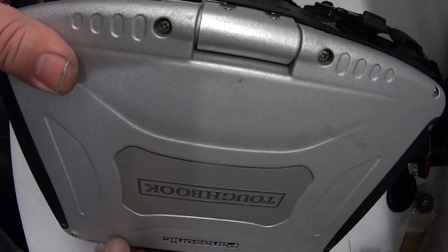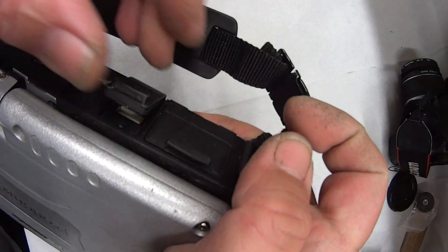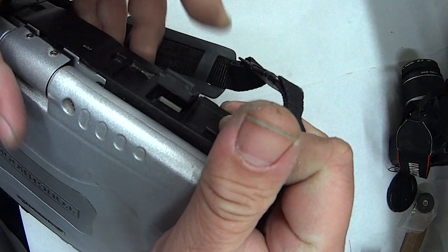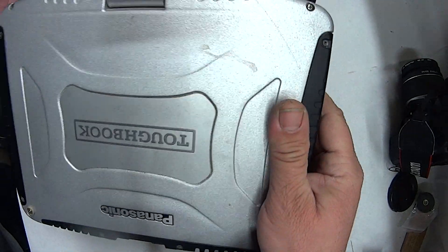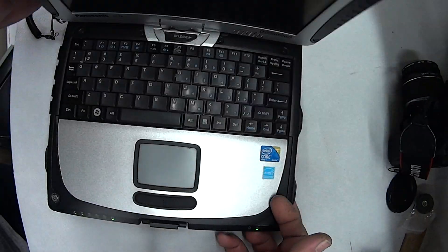What I did is I did a few checks. First of all I went to the back here. I checked my sound port which is located under this little flap, and I do have sound coming out of this port here. So that wasn't a problem, but the problem is that if you don't want to plug in speakers, you want the internal speaker to actually work.